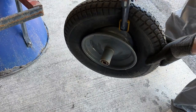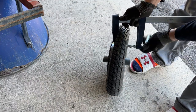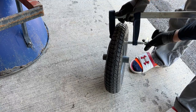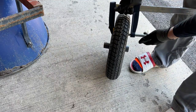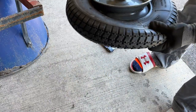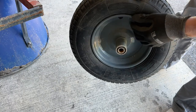So we did one half - remove the clamp, reposition it on the other side of the tire, and do the same. Actually, such a small wheelbarrow tire - breaking the bead in one spot released the entire tire from the rim.